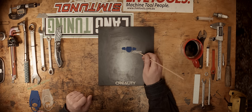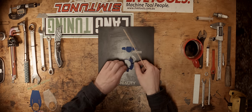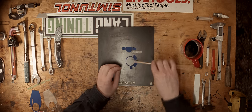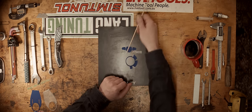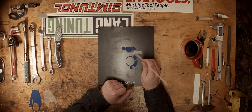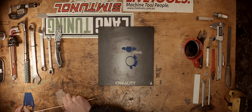This extra area is what would allow the cylinder to make more power than anything else, if everything was perfect. It would be a balancing act between how much transfer area we could achieve and balance with the extra exhaust port area. This could possibly allow us to raise the transfers. But then there's my transfer design - with a much higher exhaust port floor, I would be able to widen the A port and have the angle more steeply pointed rearwards. And because it was pointed more rearwards, I thought it would be a good idea to point this angle more towards the exhaust port to counteract the extra push. This gained me lots of area - playing around with this can gain you lots of area.